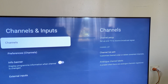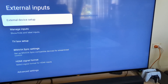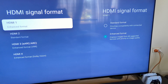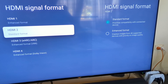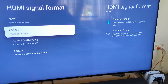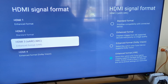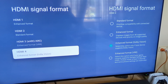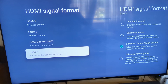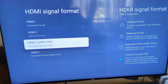Home button, arrow right to profile, settings — you want to go to Channel and Inputs. It might differ on LG or Samsung, but on Sony: Channel and Inputs, scroll down to External Inputs, then go right to HDMI Signal Format. As you can see, we have four HDMI options. Our main ones are HDMI 3 and HDMI 4 — they're the full 2.1 full-bandwidth ports that allow for VRR, HDR, and 120fps if the device is compatible. I've got VRR enabled on HDMI 3, which is where the PlayStation 5 is connected, though the PS5 currently does not support VRR.